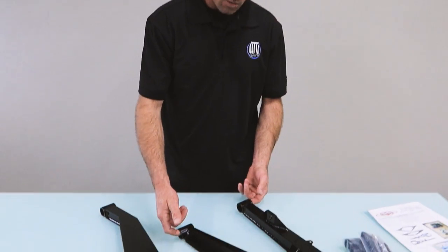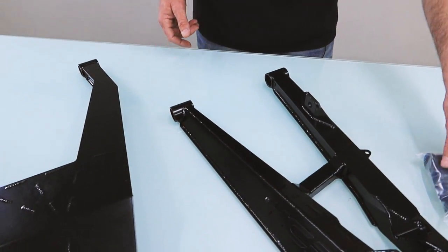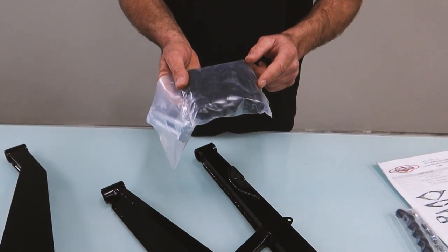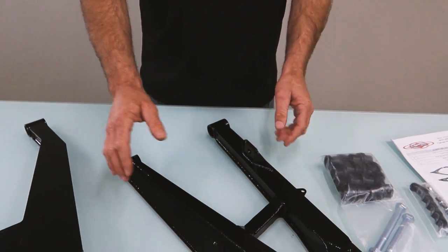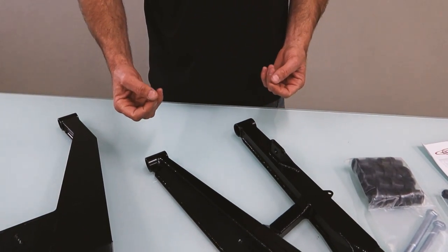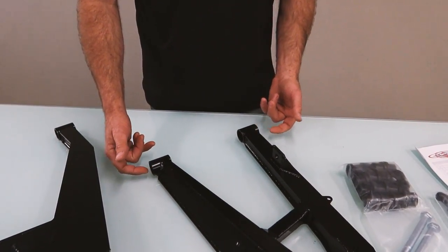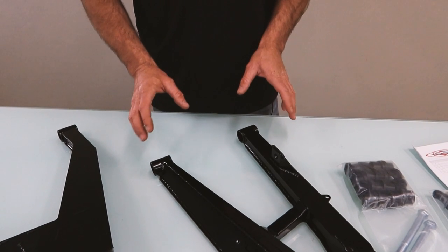It goes together very, very well. Some quick tips when you're assembling one of these HCR kits: get a little bit of CV grease, and you're always going to want to clean out the insides so that these Delrin bushings will slide in. You don't need to bang these in — they don't require a hammer. But when they come powder coated, you will get coating inside and it does take up room. It's easier to take a Dremel or some sanding paper and get in there and clean that out. It's just an easier install. If you take the right steps, you can also put a little bit of grease on the bolt so they slide through a little bit better.